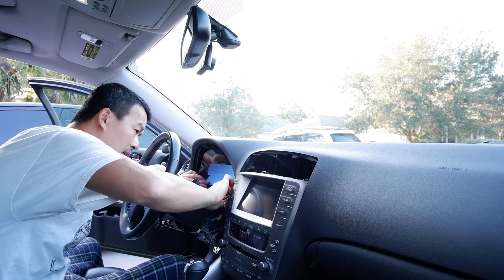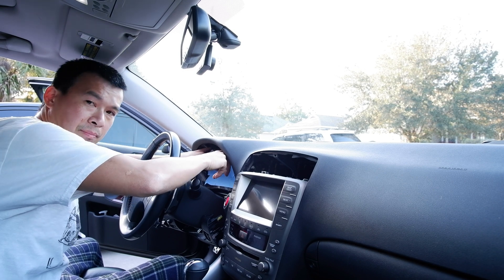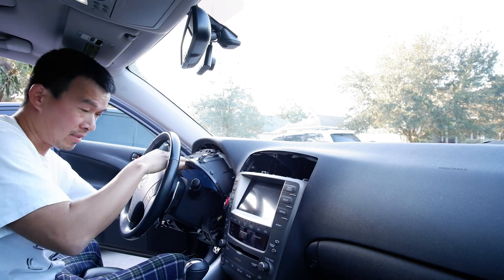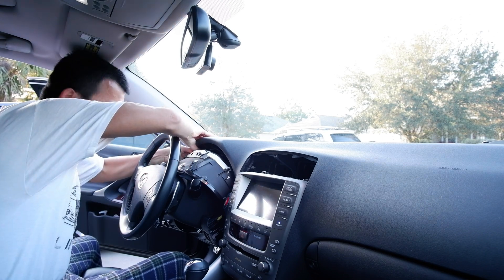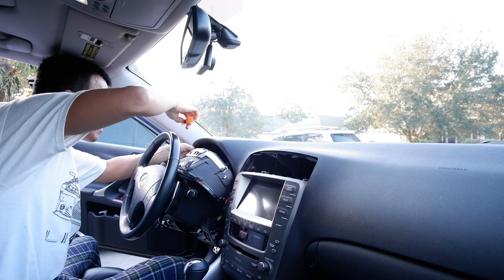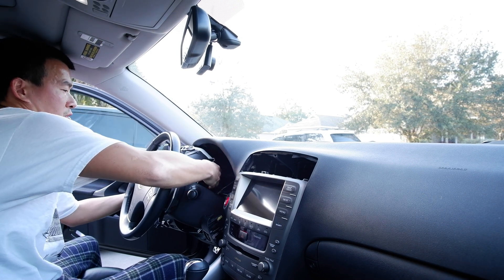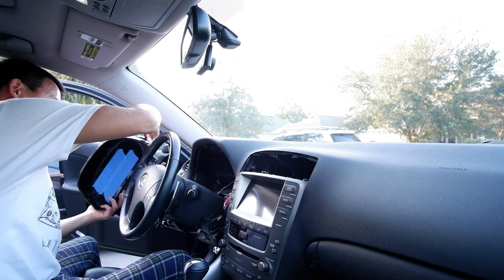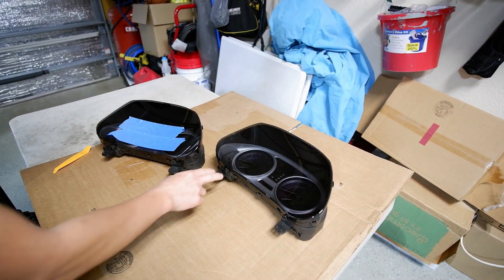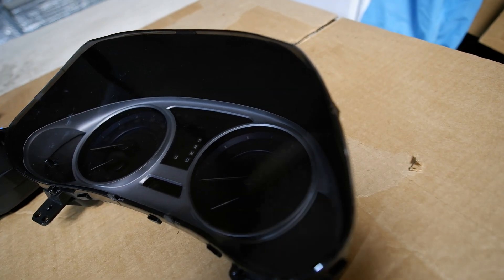Here's where it gets tricky with the cluster. If you look inside there are two little clips up here that you push up to release the tabs on top. It pops in place and then you pull it out. This is where you have the potential to scratch your lens because the only way to get it out is to fold it down and tilt it around the turn signal stalk. Without tape it just scratches this thing up. You can see those same scratches on this junkyard one from when they removed it — so protect your lens.